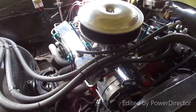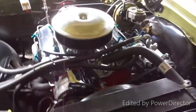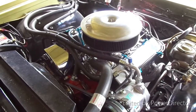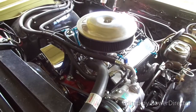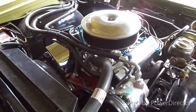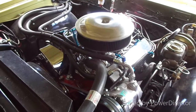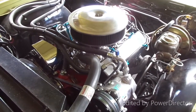As far as the initial startup went, first time I hit the key after the pump stopped, it fired and ran for maybe a second or two and then died. I turned everything off, waited a few seconds, hit the key again — same thing. After the pump primed and stopped, it started up for a couple seconds and died out again.